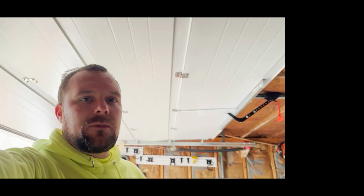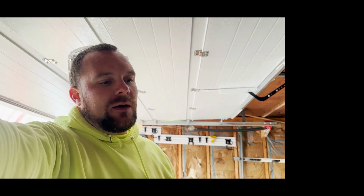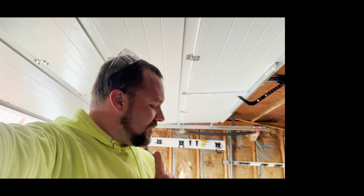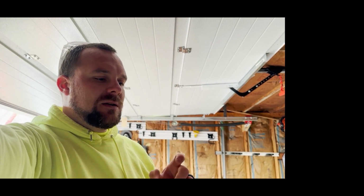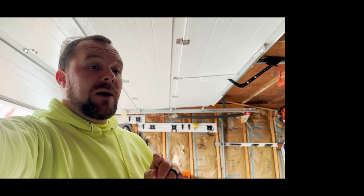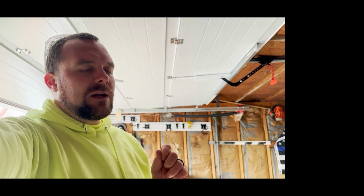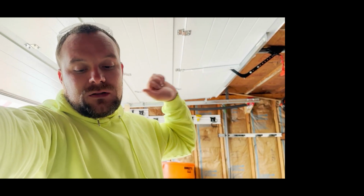All right, sorry that video got cut off, but like I said, I'm just gonna pick up where it got cut off. They send you everything down to the zip ties. Just to reiterate, the ends where it Y's off are completely different. I already kind of packaged this up, but the little junction box is different. It includes a ground wire into that box, and that ground wire has fuses. That's all different because I didn't have any ground. There might have been a wire in that box, but there was not any separate plug and play kind of deal for me on this 2020.